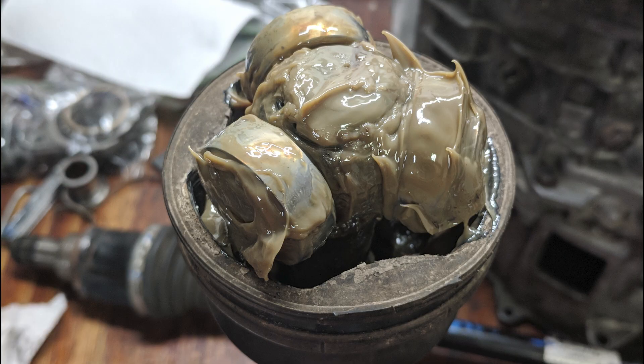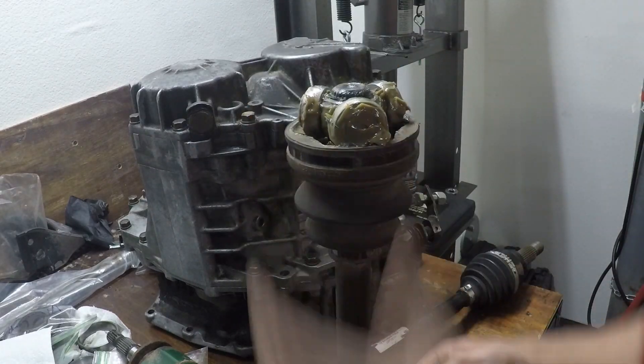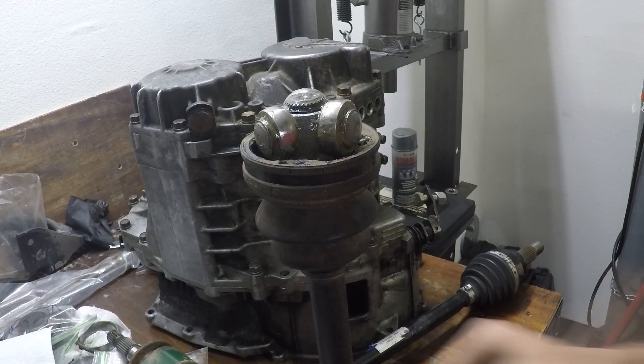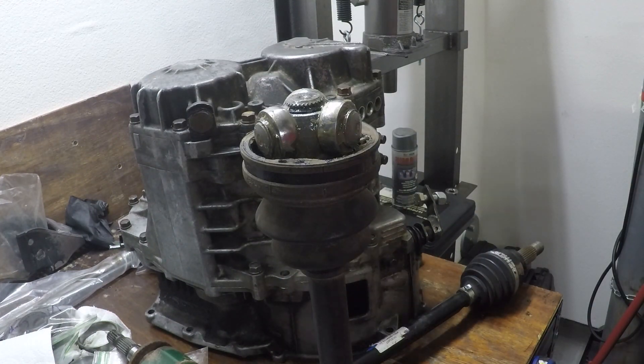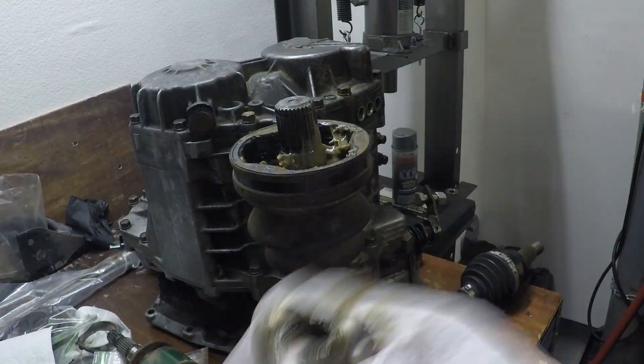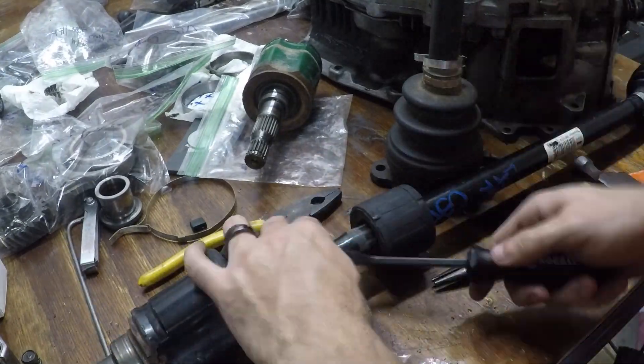Here's really what we're looking at: really old grease in the CVs. So while we're in here, we're going to go ahead and clean everything out, get everything broken down and torn apart — pretty much sterile — to go through all of this process and allow us to do our fabrication work and all of our measurements on the axle bars themselves.